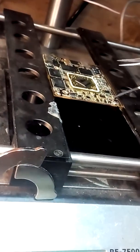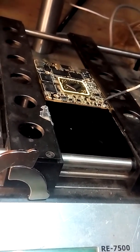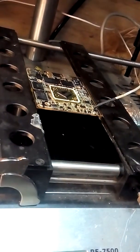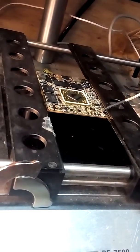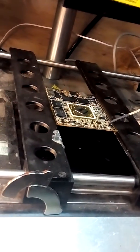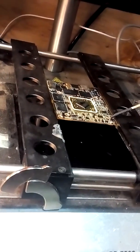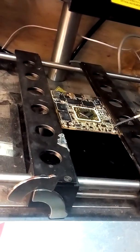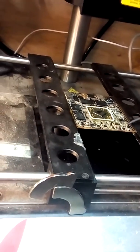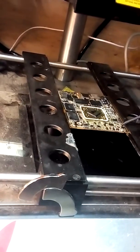Exactly, I don't think it's the graphic card. But I'm referring to the graphic card because I don't have a screen to test. I don't have the HDMI port that I can put on the back of the laptop and connect to my screen to see if the graphic card is working. I work blind here. So this is just a blind test. I could put the cable on the machine and put it on the external screen to see if the graphic card is working, but I don't have it. I don't have image on the screen — the screen comes black. When the screen comes on with lines, for example green, then you can check it. You can say it straight away — that's a graphic card. But because the screen is coming black, sometimes we know what happens. You have to do the double job.